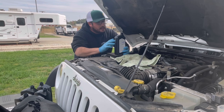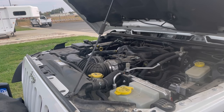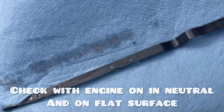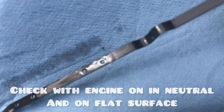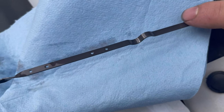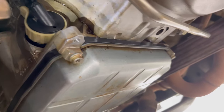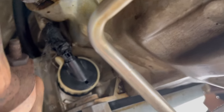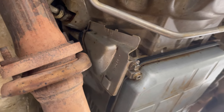I've got about four and a half quarts in — let's go ahead and start it up and shift through some gears. I've been running the Jeep for about 30 minutes now. I just checked it at idle in neutral and we're just maybe a 16th to 3/16ths over that hole on the dipstick. I think we're going to be okay — we'll leave it like that. I'm going to put the cover back on, put the dipstick back in, and then check underneath for leaks. We're underneath the Jeep and everything's looking really dry — no more leaks, which is a plus. Double-checking up top as well — everything's looking really dry up there. I'm going to put the cover back on with that one 10 millimeter bolt and we'll just keep monitoring it.